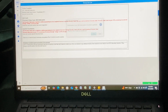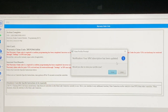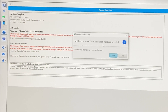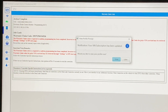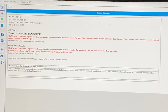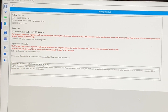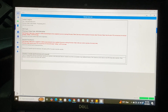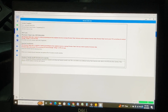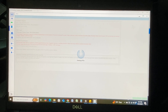Programming action complete. Since it's registered per vehicle, it's letting you know that one vehicle slot has been used. Here is your warranty claim code in case something goes wrong. We'll move on and go to clear DTCs, because chances are it set a bunch of codes in other modules — lost comms codes and such.